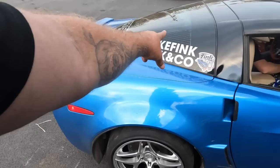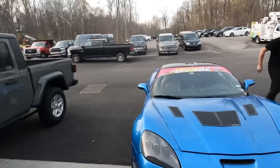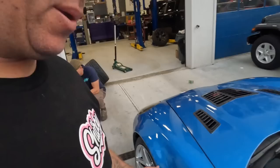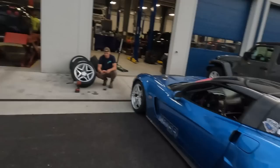Yeah, super happy. We're obviously here, Trav's car's up on the alignment machine. So we are getting ready to get the alignment done in this car. We're gonna see how much of the alignment will pull out these front wheels for fitment. We went with an 18x9 plus 22 front and an 18x10.5 plus 12 rear. So the rear is perfect. Try and ignore the tires that are currently on the car. These are just some burners that we put on, some secondhand ones.